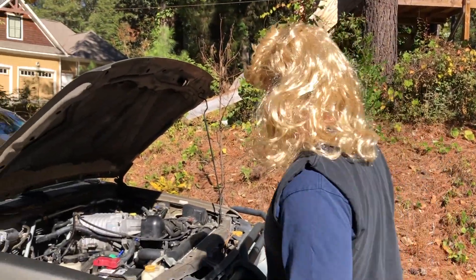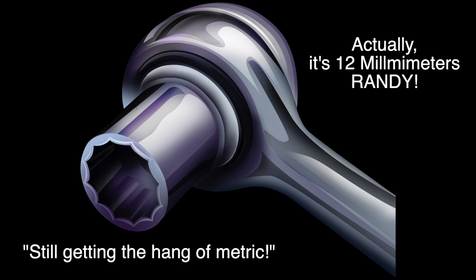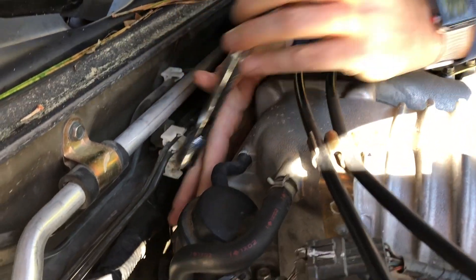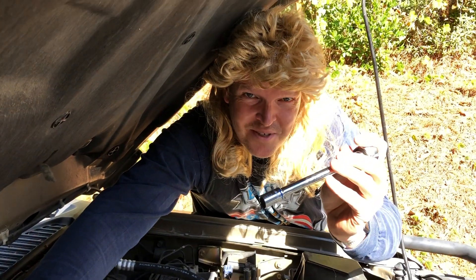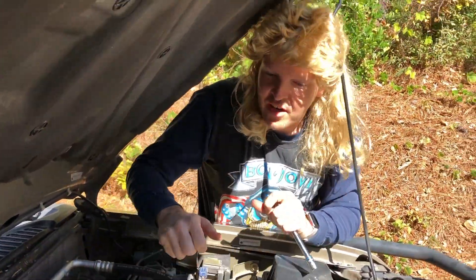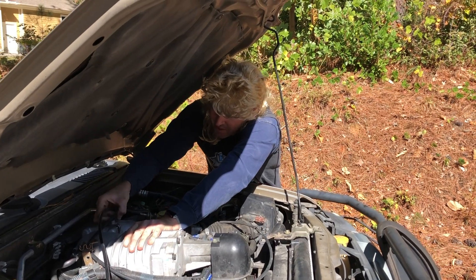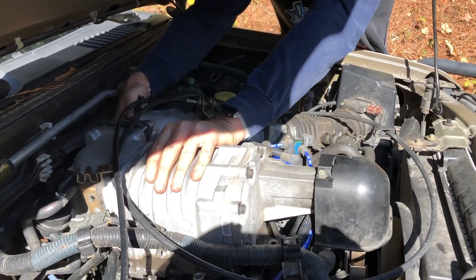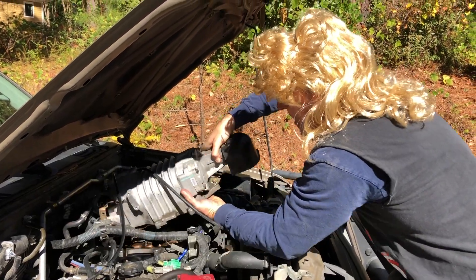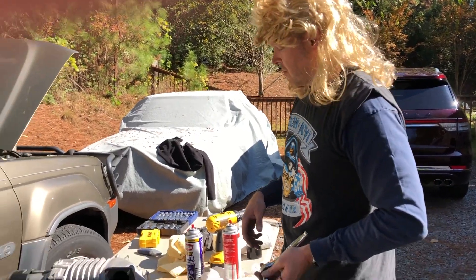We're gonna see how it's done because I don't really know — let me go get my 14 millimeter. First thing we're doing is taking off these bolts that hold the supercharger on the manifold. You're gonna want an extension for that because you can do it with just a wrench but you end up wrecking a lot of other stuff in there. So we're just gonna pull those off, get those out of the way, give it a healthy shove, and gracefully remove it — see you later, you hunk of junk.